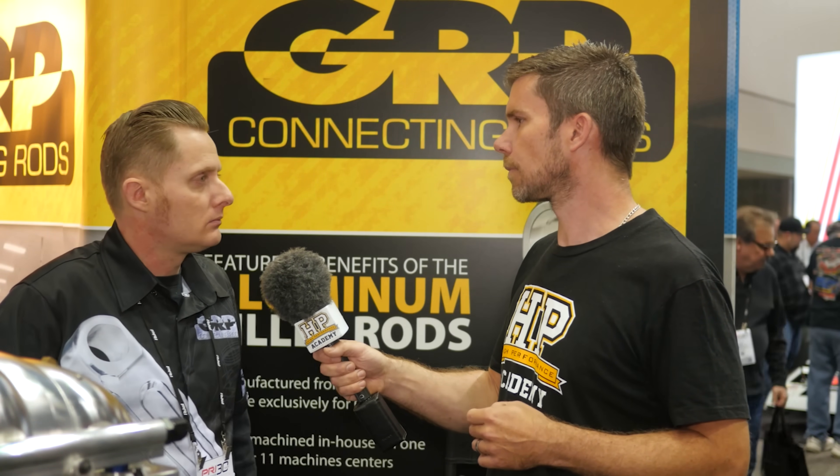A common topic is that aluminium conrods stretch in operation, particularly at high RPM, requiring additional piston-to-head clearance. However, what's actually happening is not stretch — that's somewhat of a wives' tale. The material grows thermally from expansion; aluminium simply grows a lot more than steel does. You do need more piston-to-head clearance with an aluminium rod, but the amount is often overstated. For example, a six-inch long small block Chevrolet rod grows right at ten thousandths of an inch at temperature — recommendations of 40 to 60 thousandths of additional clearance are simply not necessary.